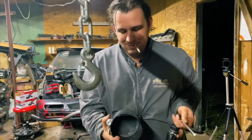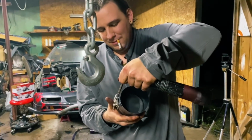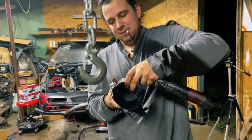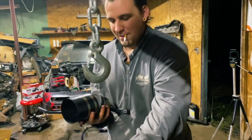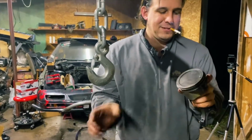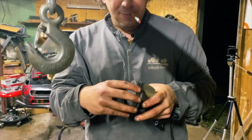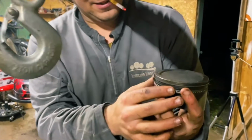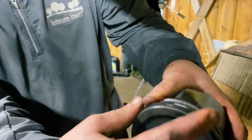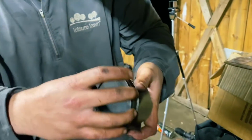Well, while you're there, why don't you tell these guys, since I explained piston ring gap, how about you guys learn a little bit something from Jay about how the piston ring should be aligned before putting it in the engine. Yeah. So in most cases, especially with these particular ones, they have a really bad blow-by problem. So what you should be doing is at least between a 90 and a 180 between the openings where you've actually got your gap. Why is that?